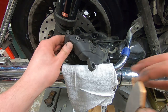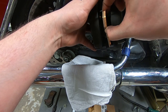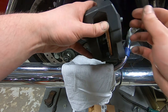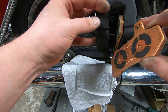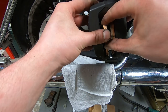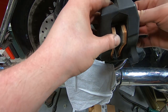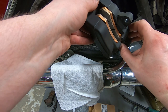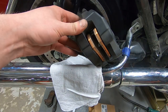let's get our brake pads inserted into the caliper. So there's one for one side and then one for the other side. I like to put it in the center and then push the whole thing up towards the pistons, just so that this anti-squeal stuff doesn't get squeegeed off, but gets applied up on the actual piston. I don't know if you can tell, but it's not right up on the edge. And then once it's in all the way, then I push it up against the piston. It probably doesn't matter at all. But now that we have it like that,